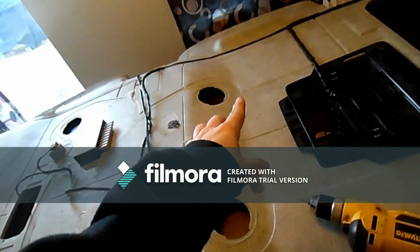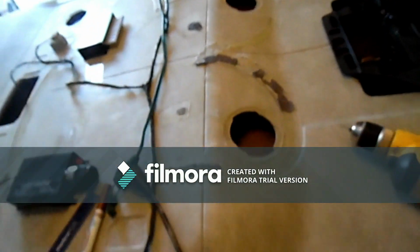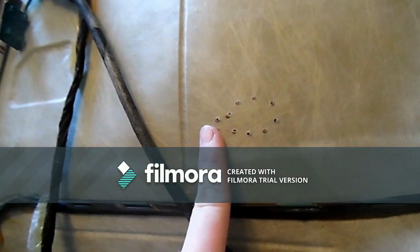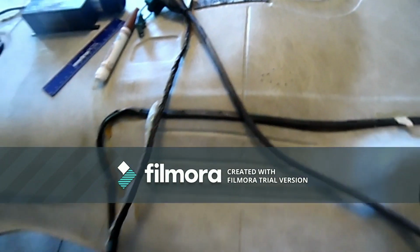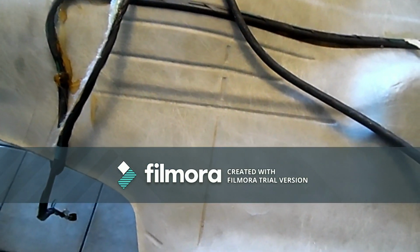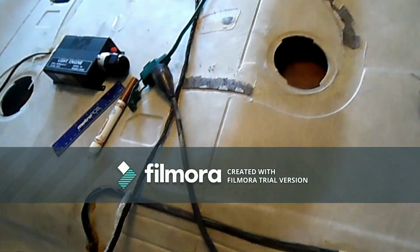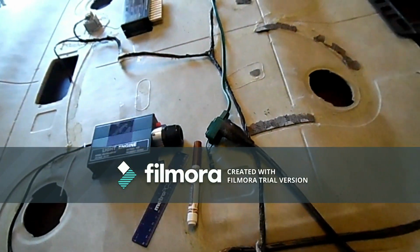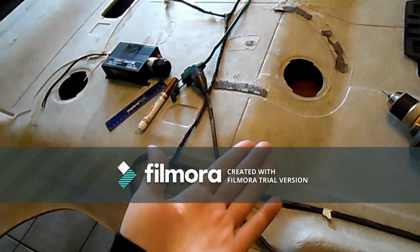Once you have all your print down, like where you want it, you're going to want to drill the holes. So I've already drilled these holes. The best thing to do is to make sure your hand is underneath it, making sure you touch the area, so that way you don't go all the way through it and damage your headliner cloth, and then you're gonna have to reupholster the whole thing, or it'll look really crappy. So make sure you have your hand underneath it.